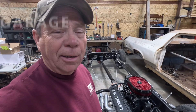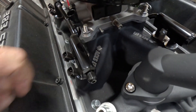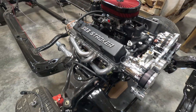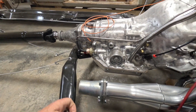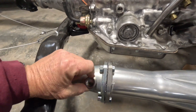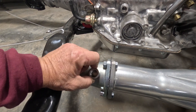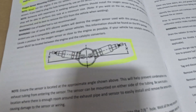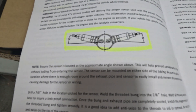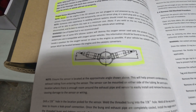Welcome back. Today I'm working on trying to add my oxygen sensors to the exhaust for the ACES electronic fuel injection. The oxygen sensors get mounted into the exhaust and I need to drill a hole and weld this little fitting on here on both sides. There are instructions that give you an idea of the angle it needs to be at to help condensation not get on the sensor.